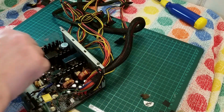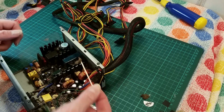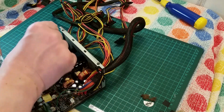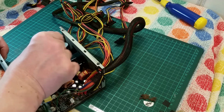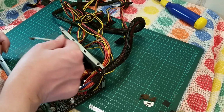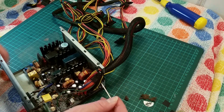But not many people think that their laptop is getting slow because the CPU's overheating. And I've opened plenty of laptops where the fan is just chock-a-block. You clear them out and give them a new lease of life. Now you can probably see the sort of dust bunnies I'm pulling out of here.